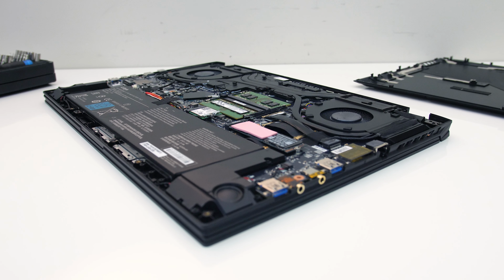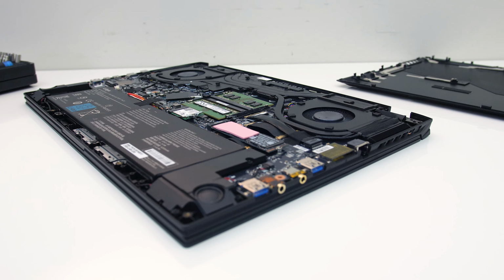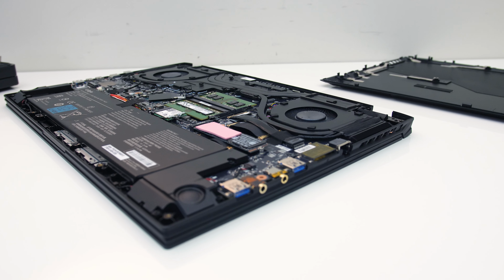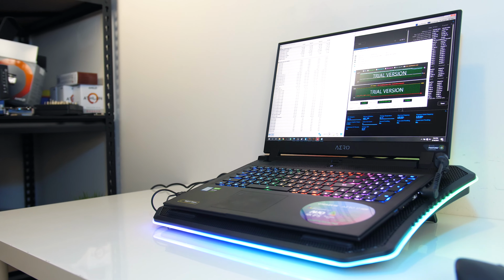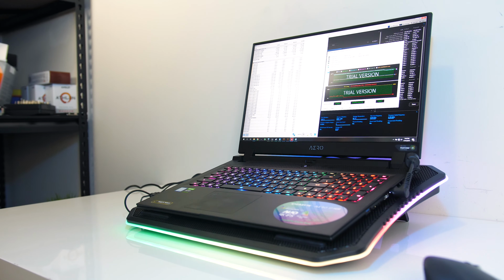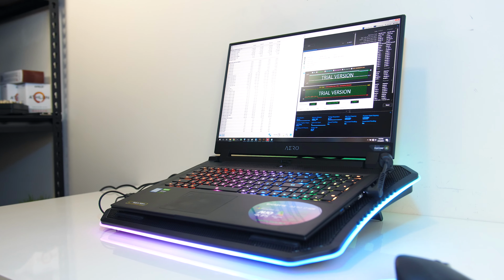I'm personally happy to take the hit so temperatures don't go above 90. Even at stock, simply by raising the fan speed, we're able to get pretty good clock speeds, especially considering these were over 8 cores, while some simple undervolting improved things further. In my tests, just by undervolting with raised fan speed, even under combined CPU and GPU stress test, we're almost at 4.1 GHz on all 8 cores,